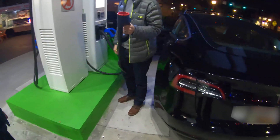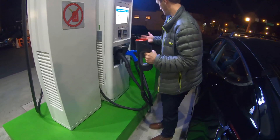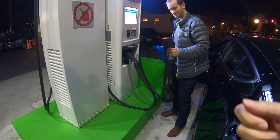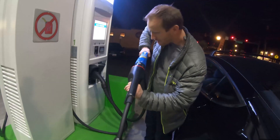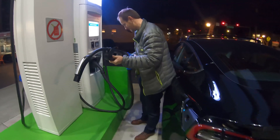It does help to get that done ahead of time. So now you're going to need two hands, and you're going to take out that blue one, which is your CHAdeMO. You're going to push the lever in and then pull out, and then you're going to click the two together. You see these two grooves here? There's a top, and then the two grooves will line up. And then you push it until it clicks. There you go. And now you're good to plug it into your car.